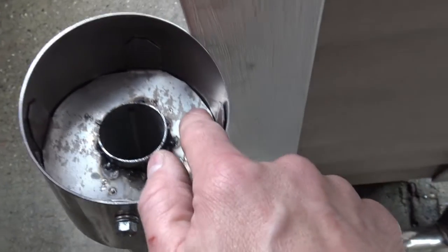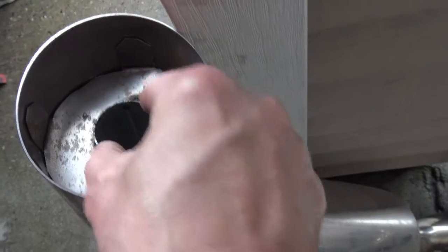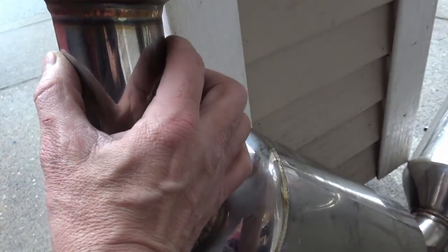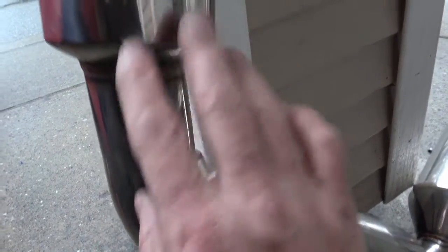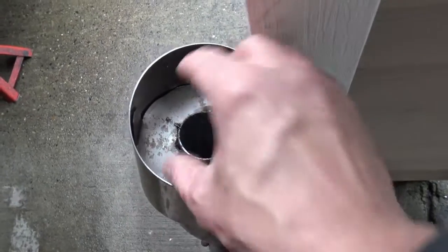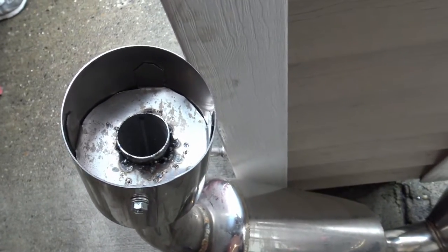It fits fairly tight in there, not too bad. And then I welded in an exhaust pipe — this is a one and a half inch exhaust pipe that goes all the way back from here to just about where it enters the smaller two and a half inch pipe. That's how most of the exhaust restrictors are designed. I'm not sure exactly how they work — I guess the sound waves hit this plate here and then bounce back into the exhaust, and that somehow reduces the decibel level. I'm hoping it works.